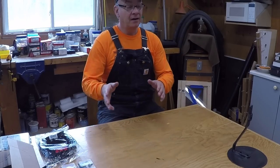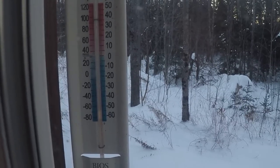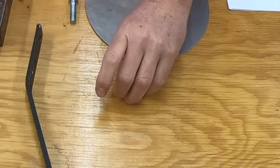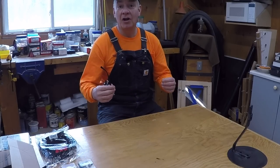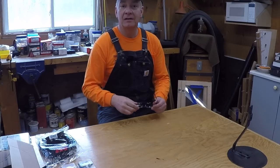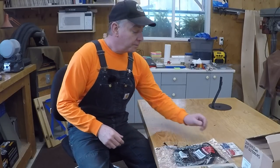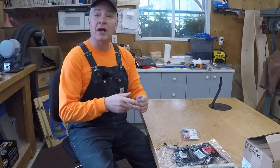I'm going to put together and prep the light onto the mount before I head out to the tractor. A couple of reasons: it's cold outside and there's no room at the inn. The second reason is there are a couple of really tiny screws that have to be placed into this light to secure it back to its housing, and if I drop one in the snow there's no chance I'll find it. I've taken a measure of how much wire I need to get to where I want to connect behind the LED work light. I'm going to use bullet connectors because they've got a nice low profile, and I want to be in a position where if I ever need to remove this light or replace it, I can disconnect easily without having to cut or splice wires again.